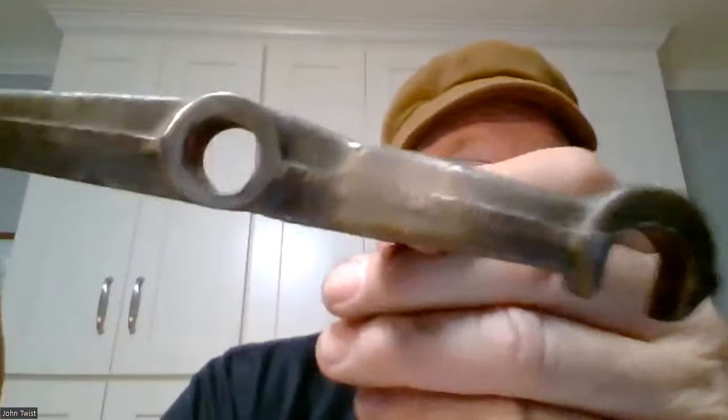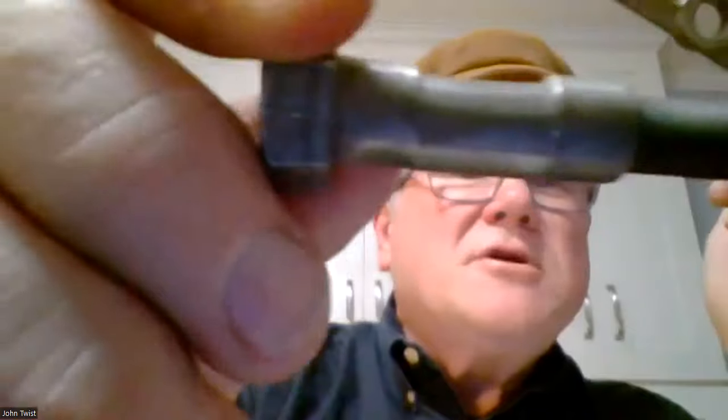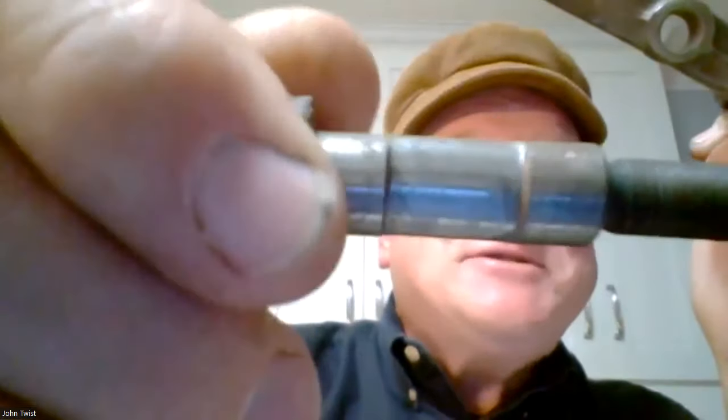Okay. There are other friction points. There's a bolt that goes through the release bearing fork. There's no bushing here. These can get worn pretty badly. I happen to have an example here. Always replace that bolt and bushing. So here's the elongated hole. I don't know if you can tell it's elongated, but it sure is. And here's the bolt, which shows a little bit of wear. This thing's really beat up. Yeah, I always change that bolt and bushing.